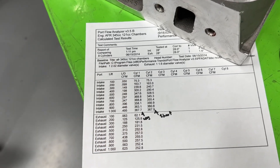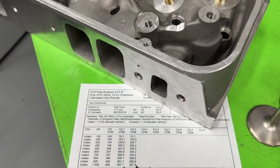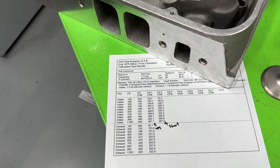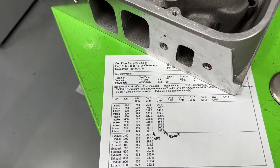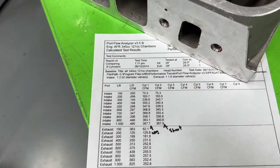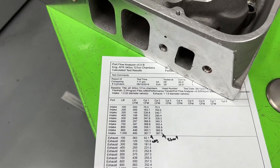From 0.100 to 0.500 lift it's outstanding. After that it's okay. That shocked me — I never would have thought the smaller 325 head would outflow the 345 at peak. But it does, and that's new to me. I've flowed several 325s and they typically do 390 CFM — this 345 is only at 370. I'm going to be fully porting it, getting larger valves at 2.350 with 50-degree seats. I'll probably lose some of the 0.400-lift flow — maybe drop 10 CFM there — but peak should go up to around 430-440 CFM.